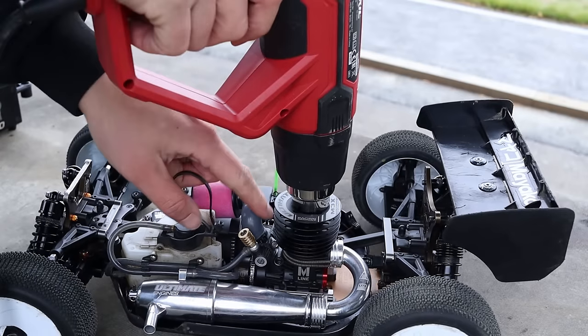Okay, now for the oil bath. So I said I would return to it, and here are my thoughts. The thing about the oil bath is that, yes, you are heating up the engine because it's submerged in oil that you heat up to a certain temperature. You remove the head button, the cooling head and the back plate, and everything is lubricated very well. And because there's really no compression in the engine, just the pinch of the sleeve on the piston, the stress on all the internal parts is less, which is a good thing.